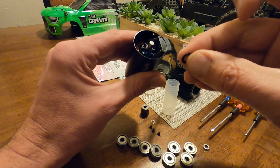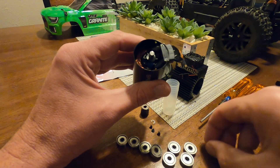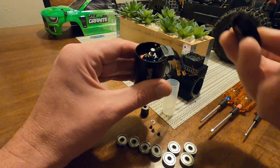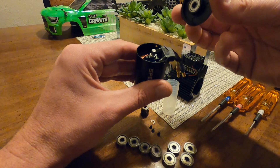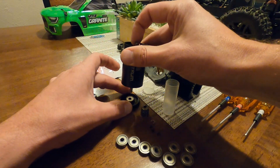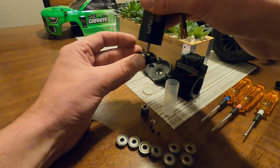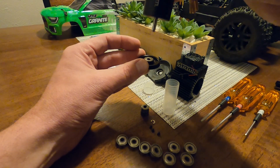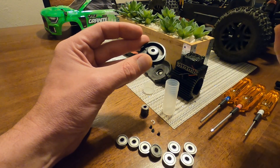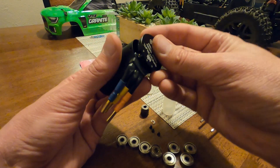At this point, put the curved washer with the curve bending downward toward the motor, then put on the spacer — or thick washer — with the beveled edge facing up. To finish it off, put the end cap with the bearing on top. If you need to replace the end cap bearing, there's a trick where you put tiny breadcrumbs in, push down, add another breadcrumb, push down further, and it slowly raises the bearing up and out — it's called the breadcrumb trick. I didn't need to use it this time since that bearing works perfectly and is protected at the back side of the motor.